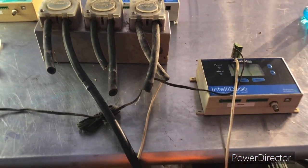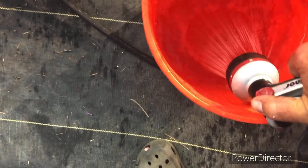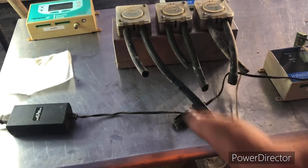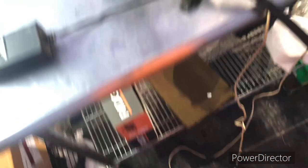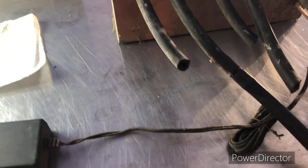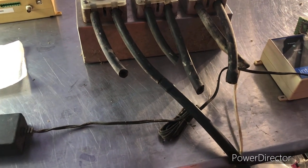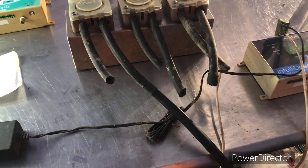The plug pinouts actually control which pump runs for which function — it's a combination of the pinouts on the plug and the software settings. We'll test each pump one by one. You can see the flow arrow right on the pump. One of the units had extensions already on it, which is handy. We'll put an extension in to draw water out of a bucket and let the pumps circulate for a few minutes to wash them out.